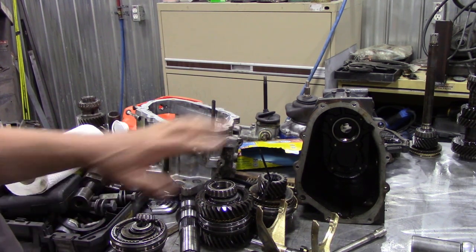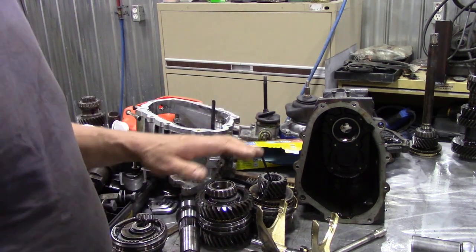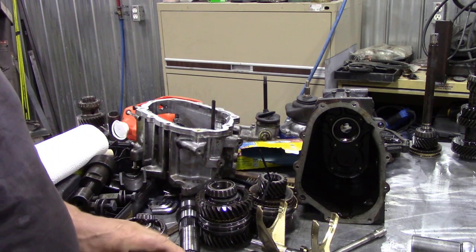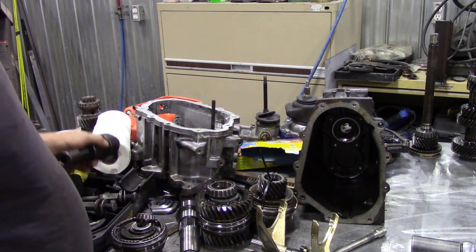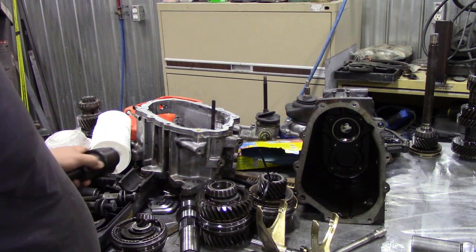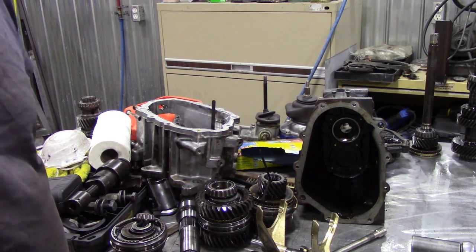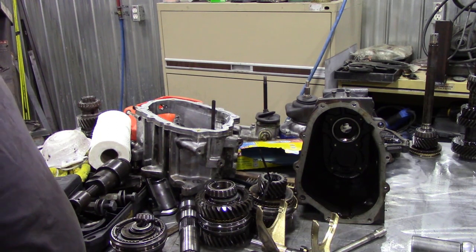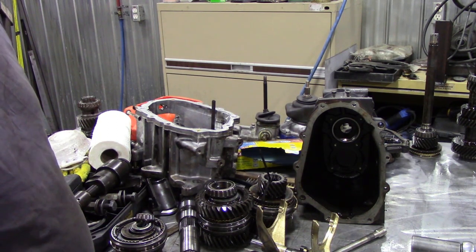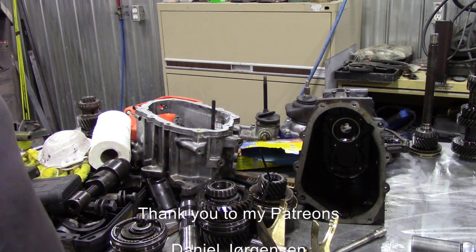Sometimes you can cut corners, because otherwise we could have just replaced everything, every bearing, every nut, bolt, washer. But in this case, we can actually salvage it by doing it ourselves. And there are one or two tools that you do need. This is really handy, this piece of kit, to pull off the bearings, pull off the sleeves and the bearings, etc. But I think you could do it if you adapted a three-legged puller or something like that. So you can make your Land Rover better on a budget. And why not have a go? What's the worst you can do?